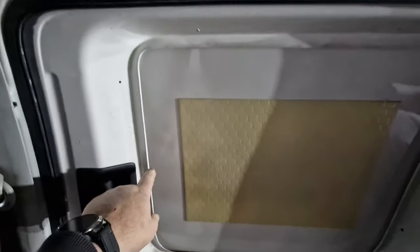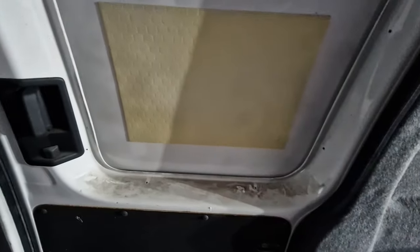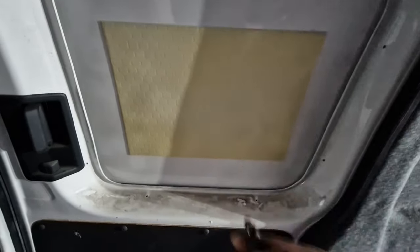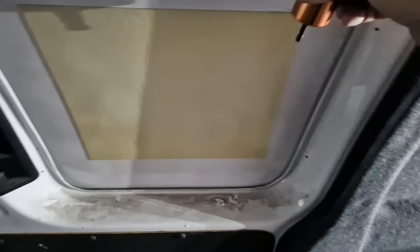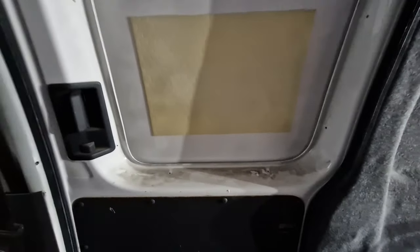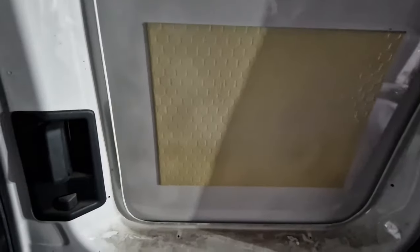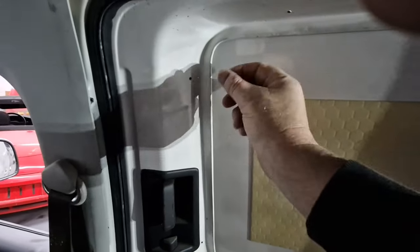It's dead easy. Your guide is the inner section here, which is the manufacturer's point to put windows. I use a metal nibbler — it has a fixed end and a rotating end. I use this to keep the drill in the set position and go around any angle. It gives a nice, very neat edge and doesn't distort the metal. I've seen people use grinders and reciprocating saws — it just trashes the outer edge, which makes window fitting more difficult. Sometimes you need to push this section forward to meet up with the outer section to put the U-trim on. There are loads of different ways of doing it; as long as the U-trim goes on flush, job done.